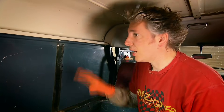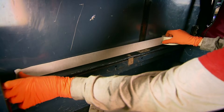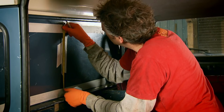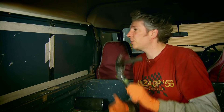With the reinforcement out of the way, I can now concentrate on marking out the panel. I'm going to do most of my work from the outside of the vehicle, but first I need to make sure I've got my centres on this side correct. I'm using masking tape to mark where the window is going to go, then I'll drill a hole through and do the rest of the marking from the other side. The rear window should be equidistant between the front and back of the rear cab, so I'm measuring and marking my centre point, then transferring the window measurements to the masking tape to mark the edges of the hole. I'll drill through the centre and the edge markings so I can measure from the other side and make sure everything is just so.